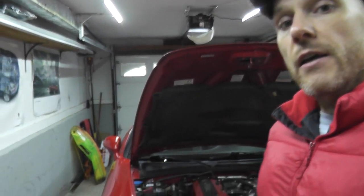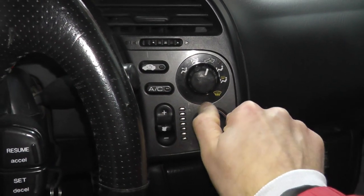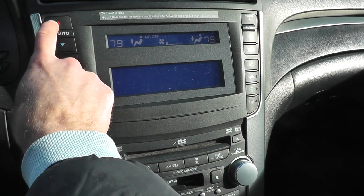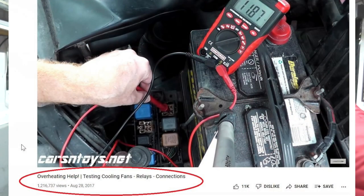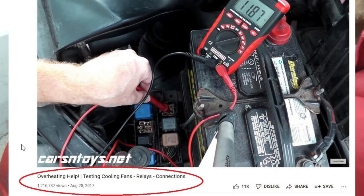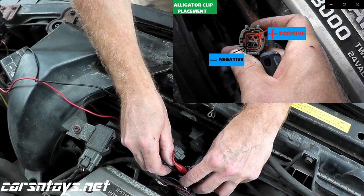We are going to bleed the system together. Two things very quickly: if you're not sure if this is your problem, something you can try — once the vehicle is up and running to normal temperatures, even once it starts to overheat, turn on the heater. If cold or cool air is coming out of the vents, that's a very good sign that you need to bleed the system. That's number one. Number two: after you perform these steps, I'll include a link in the description box below to an overheating help video that may have over a million views. You can read the comments — it's helped many, many people, so give that a shot as well to pinpoint what's going on.